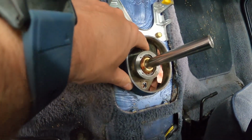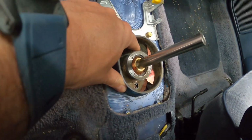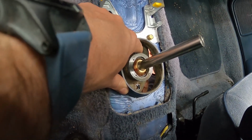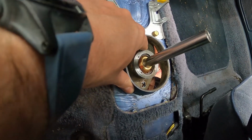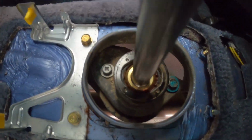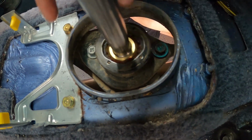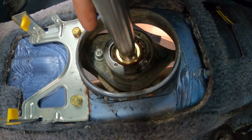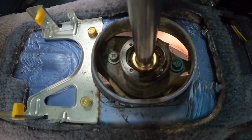So the top view, you're going to have where my finger's at, and then where my thumb goes, there's another bolt hole there. It already had some kind of fastener that's sort of welded to it, but in this case, the car being a little older, and yours probably the same maybe, that didn't want to lock. So we took it out all the way, and we just threw some 10 millimeter bolts in there. Looking from the top here, you can see we've got a 10 millimeter here and a 10 millimeter here. Your install, like ours earlier, had basically a fused kind of stud that was there, but they broke loose just from being old and brittle. So we just replaced them with two 10 millimeters, and to be honest, it's probably easier just to take them out now.